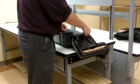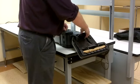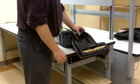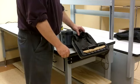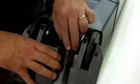To replace the lower duct hose, twist it counterclockwise into the bottom of the motor housing until the hose is hand tight, approximately two turns. Compress the hose back towards the motor housing and attach it to the cuff on the vacuum's power head.